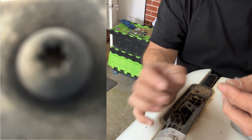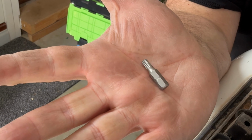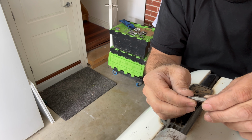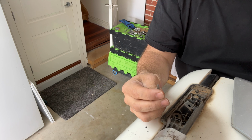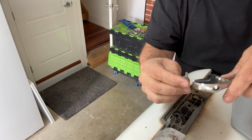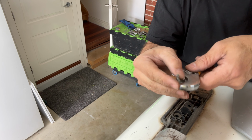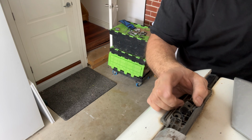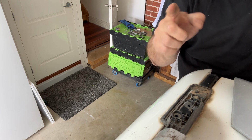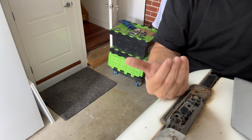Now, underneath the rail just here, and I'll show you a close-up of it, there's these special screws. I can't recall what they're called, but this is the screw that you need to get them out. And this one in particular is a T25. Literally, because it's so tight, you gotta pop that in underneath. You gotta use a shifter, pop it into a shifter, and then tighten it like this. Obviously these screws are put in before the whole rail is put in. And then there's a midpoint as well. To get to the screws for the midpoint, you gotta remove the roof lining, and they are actually bolted from underneath.